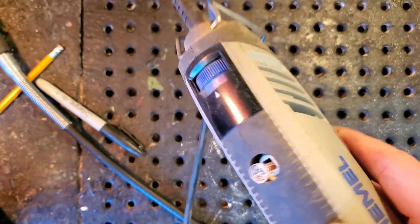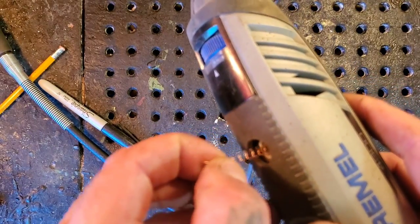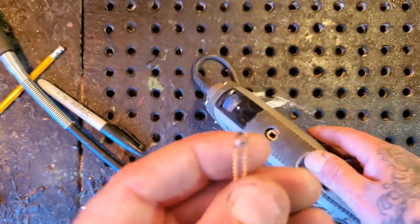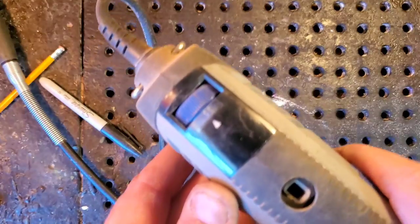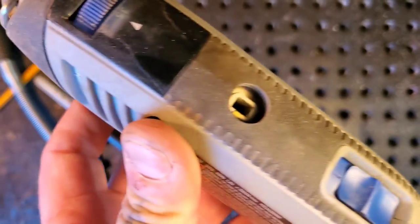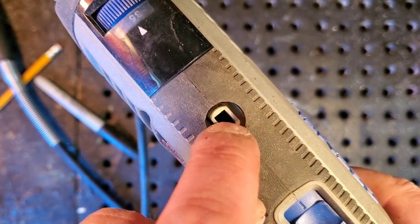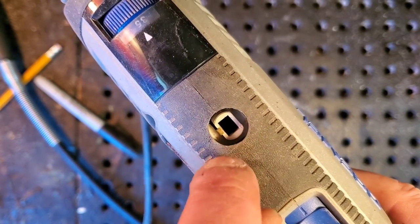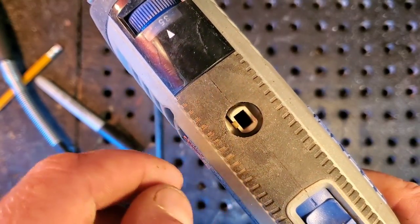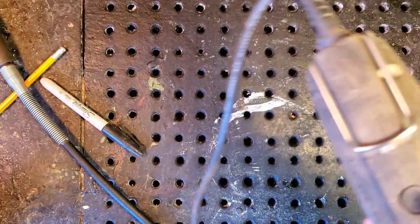Okay, see that spring pop out of there? See, it's stuck in there. The spring melted. Look, there's no brush on it. It's completely worn off and it's stuck inside the shaft. If I can see inside there. So now I've got to get a screwdriver and scrape that out. That's terrible for your shaft inside there, guys, because I'm going to scrape it with a screwdriver. So let's see this one.